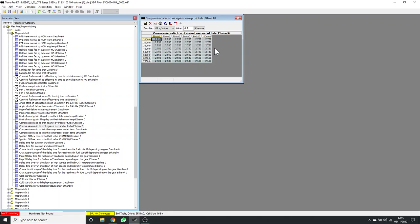This really isn't any more difficult than old-fashioned electronic boost controllers, except it's backed up by all the integration with the ECU and all the safeties involved. It's a multiplier so it doesn't have units, but the ECU works in metric units for pressure — 1000 hectopascals or 100 kilopascals is roughly one atmosphere. If you take the number at 7000 RPM, that's 2.5 — knock off one to get your relative boost pressure, that's 1.5, so 1.5 bar, roughly 22 PSI. And 2.75 minus one is 1.75 bar, roughly 26 PSI. So here we set 26 PSI going down to 22 PSI. If you want more in the mid-range, you can set it higher there.